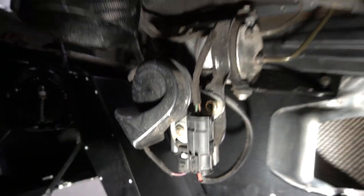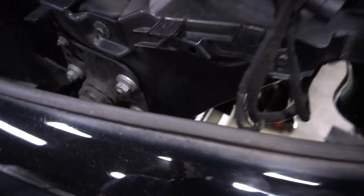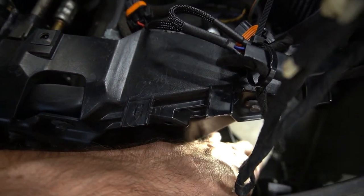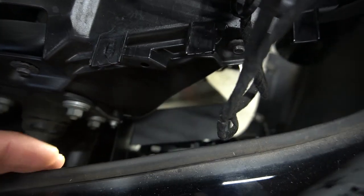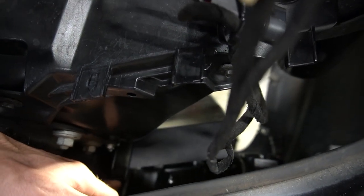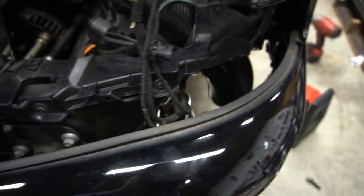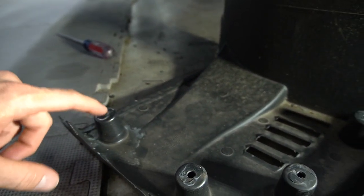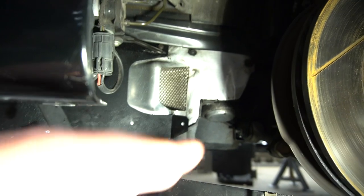It's just sitting there. But I basically wanted to do that because I wanted to know how far forward I could fit it. So if you come in here and look, looking straight down, headlight removed, this deflector can only go so far because it contacts the fog light part of the bumper. So what I've done is backed it off a bit and marked it with a Sharpie. Then when I pull the bumper off, I know how far forward I can come. And with the bumper removed, I'm gonna mock up the pork chop because there's another contact point here. So I need to see where I need to put the water deflector in the other axis.